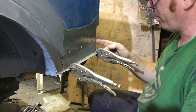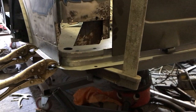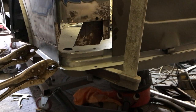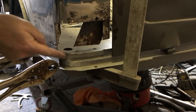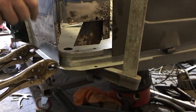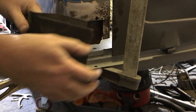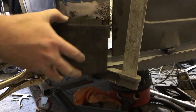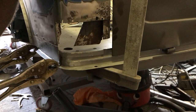There's not much to this bottom edge because there's a fold here. I haven't put the swage on it, but looking at it now there wouldn't be too much of a swage anyway — the 90-degree swage can't go all the way down because it would just hit the floor, so it must stop here. How they join this bottom bit to the other panel going around — I'm not sure. You can see on the other panel the swage has been chopped short. I'll have to do a bit of research on that.